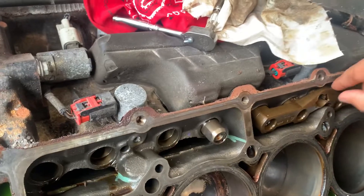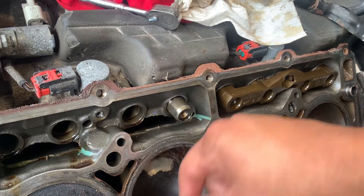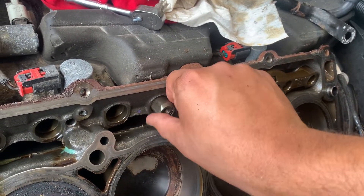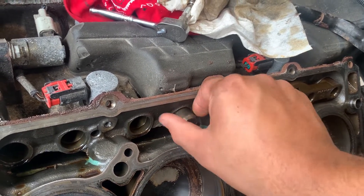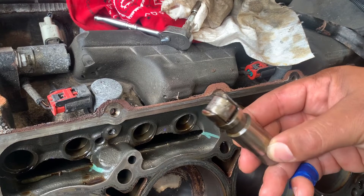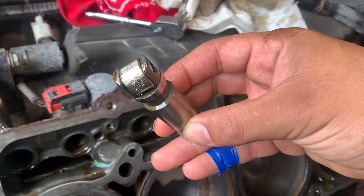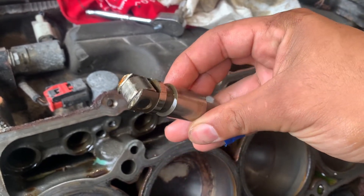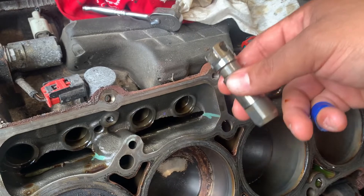Alright, so I came back and removed the lifters — look what I got. When I removed the whole unit, which uses an 8mm bolt right here, I found this one. It's supposed to sit with the flat top and bottom, but it was rotated on its side. And look at that — it is destroyed. It got stuck or rotated for some weird reason.